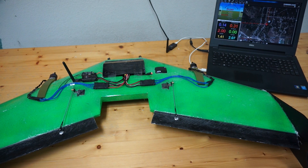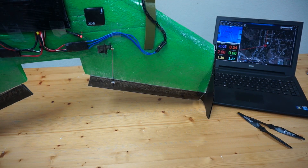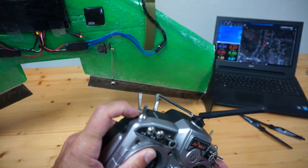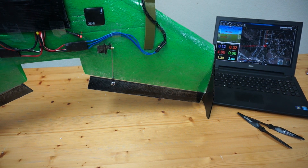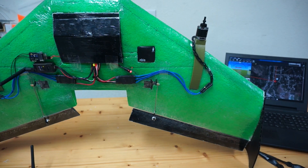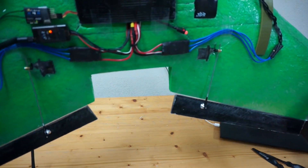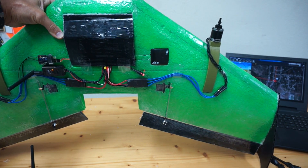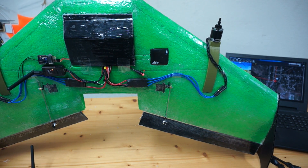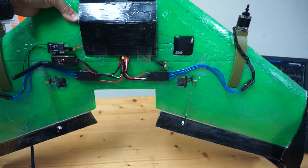We're going to transition into Q-stabilize mode now. While I do that, keep an eye on the heads-up display in Mission Planner. Everything is a little bit wonky going crazy, and I'll transition using my flight mode switch. Now we're into Q-stabilize — you can see that our horizon looks good. In Q-stabilize mode, as I move the wing back and forth, you can see that my control surfaces are moving to keep everything stabilized, hopefully vertically level. I configured this as a wing and made sure my elevons were correct, so I'm assuming all of these orientations and directions are moving in the right direction.